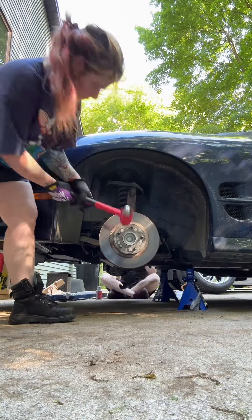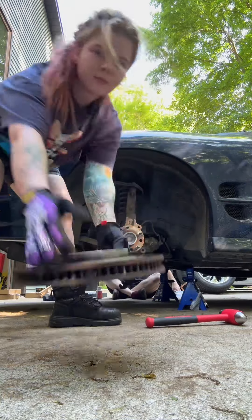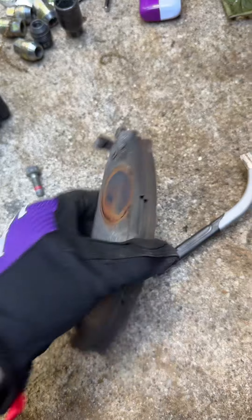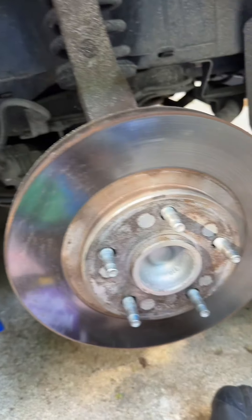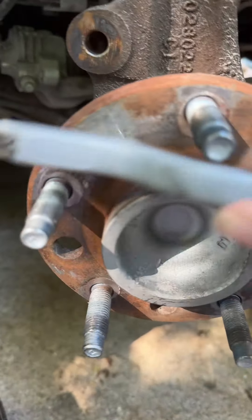We're working on my mother-in-law's brakes. Over the years I've seen people mess up their own brakes, so I'm going to point out some things you need to know. Obviously — but not so obvious — put the pads back on how you found them. I have seen people put the friction material on the outside instead of the inside.